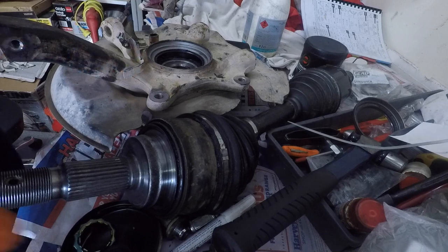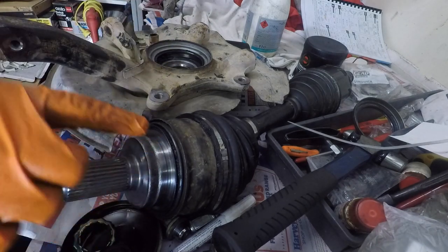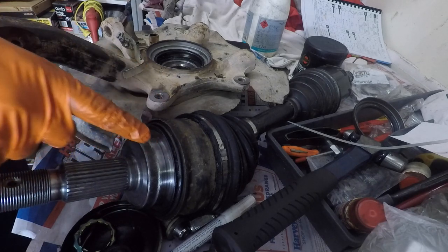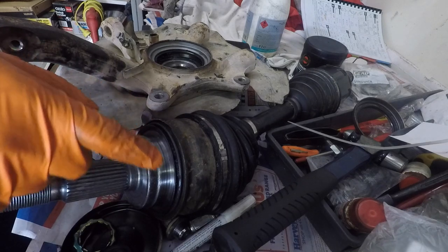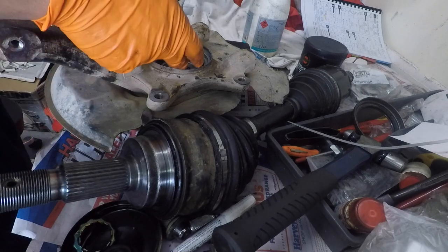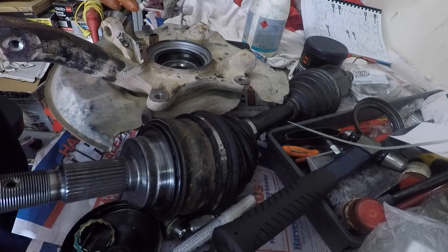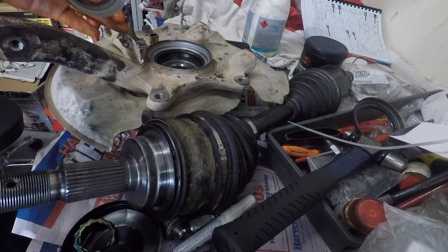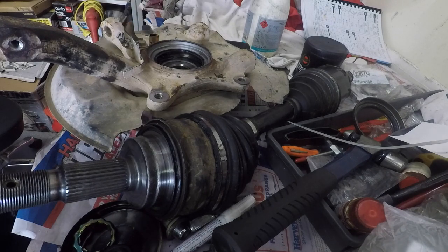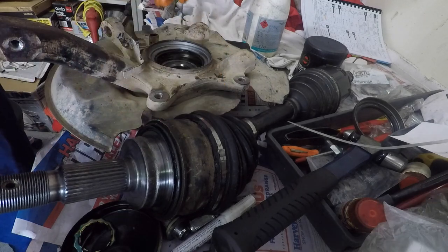So what we'll do is pull this one out, fit this, and before we mount it to the drive shaft, we'll have to grease this V-ring lip here. And that's what seals any sort of water and contamination from this side going in. There's also a bit of a labyrinth arrangement around here as well. So if you're failing your front wheel bearings often, you may want to check that inboard oil seal on the knuckle. Okay, so just notice this is dented too.